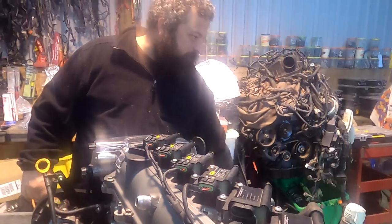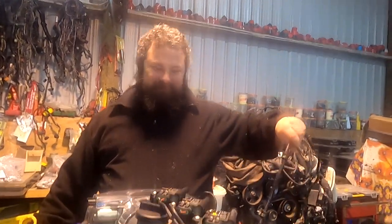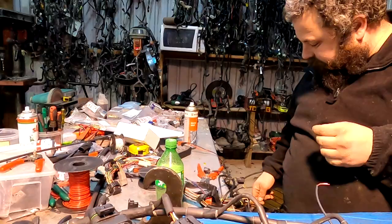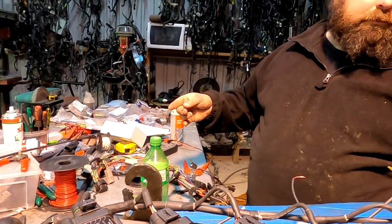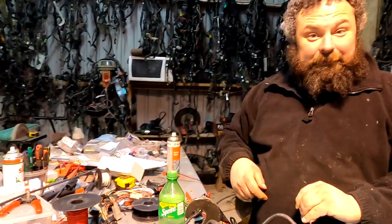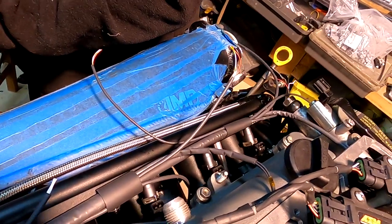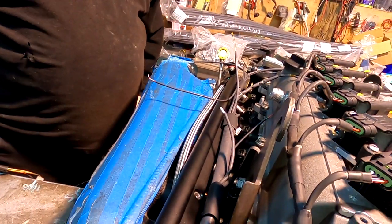Moving the V8 parts out of the way - it's longer than the table. He's got pins for those to reuse. That's the MAP sensor - he's keeping the older one because it's a 7-bar unit. Running more boost now, probably going to end up with 30 psi. The 7-bar MAP sensor is already fitted. He started the wiring loom at nine and it's done.